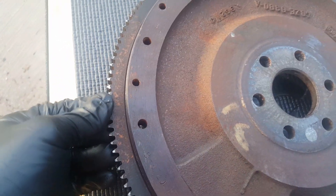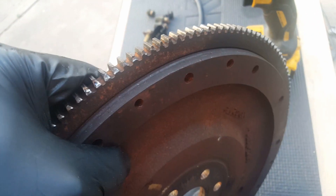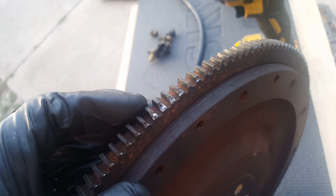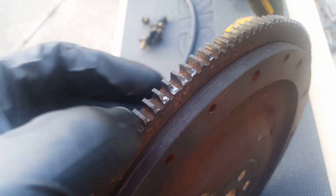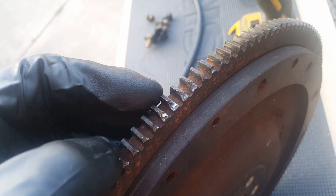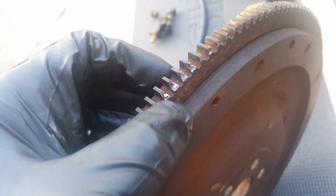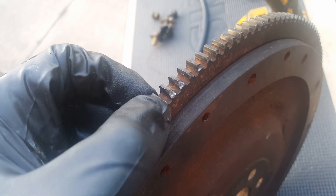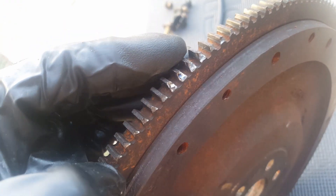The reason I'm doing this video today is if you're having issues — this applies to both GM and Ford users — this is something to consider. It's going to be really hard to see this unless you take your starter off, but I made it easy for my viewers today. I'm actually showing you what your starter will do if it is engaged while the flywheel or flex plate is already spinning. You can see what it does: that arm coming out of the starter engages and essentially grinds off some gears, starting right about where my thumb is right here.